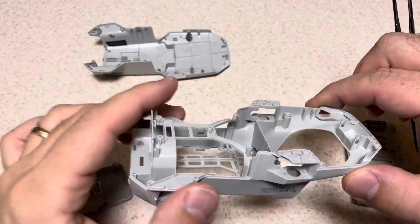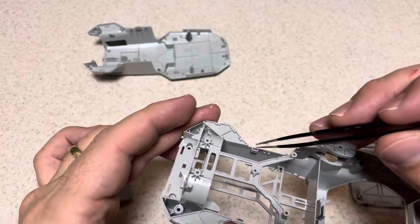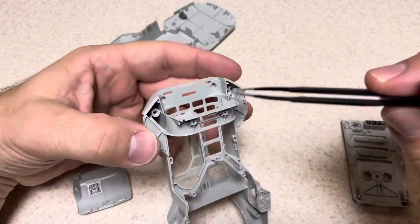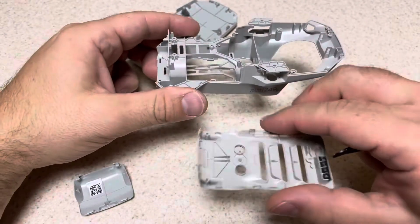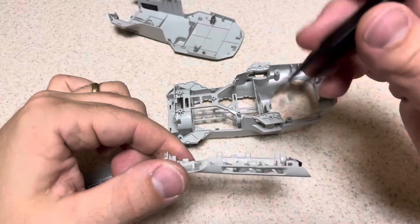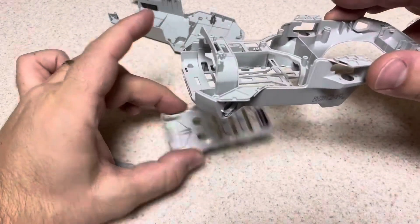Looking at the frame with everything removed component-wise, you can see where some of the clips are held in place — those are the center wall ones. Once you've removed the upper clamshell, you'll have better access from the battery pack section to the two screws to remove from the bottom of the shell. This lower shell also has six snap-ins, three on each side. Once the top is off, reach your tool in; if you can get one whole side off, the other side will come off a lot easier.